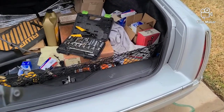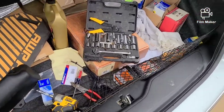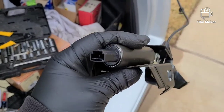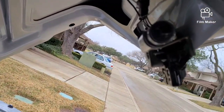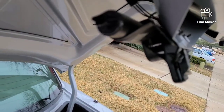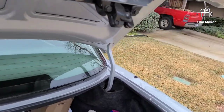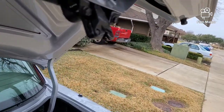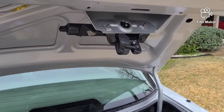The one you'll want to pull depends on the year — in 96 they did an update change. In the 94 and 95 model years they had a flat, wider little plug-in. From 96 on up they went with a different style of plug. The one I ended up using came off a 2002 Eldorado, and it looks something like this — it has the updated connector and the cable.